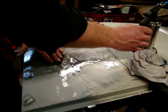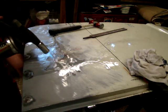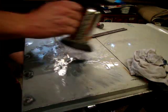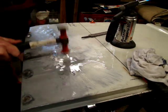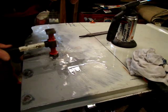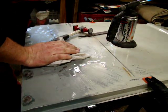Start with the butane gas, get the heat quite localised on the high spots, and then get it to a nice cherry red. You can't see it that well in the video, but sometimes if you get it quite hot the material actually raises up and you can see the material stretching. You then have to work from the outside with the panel hammer, working your way round the outside to draw the material in.